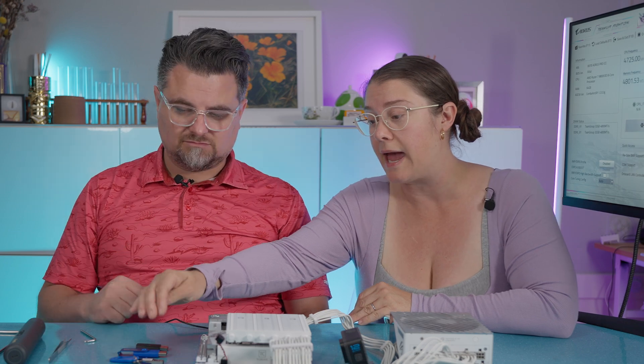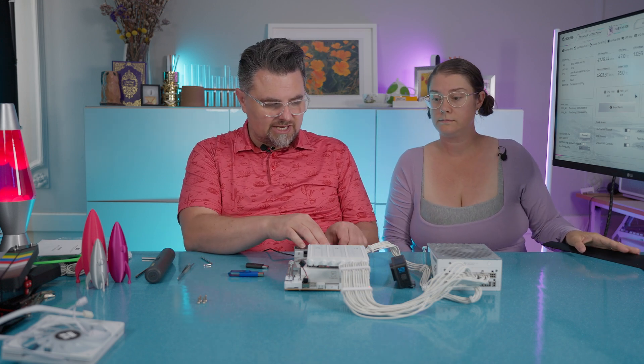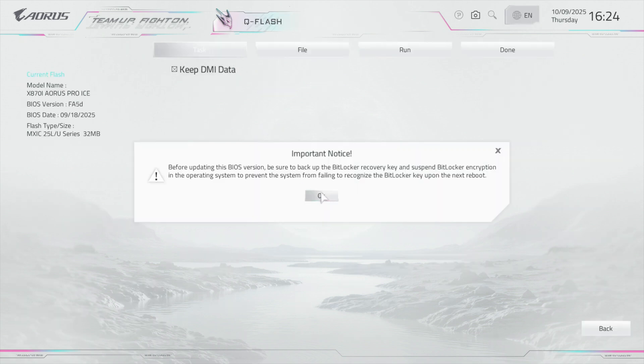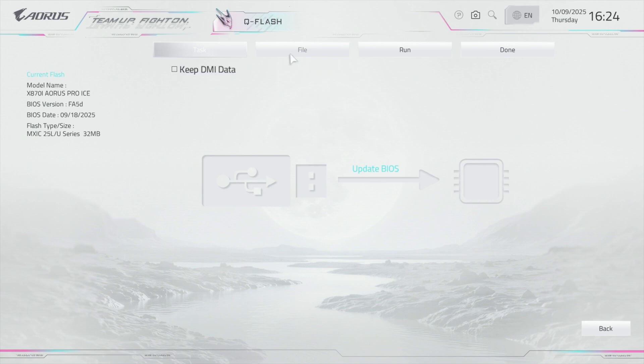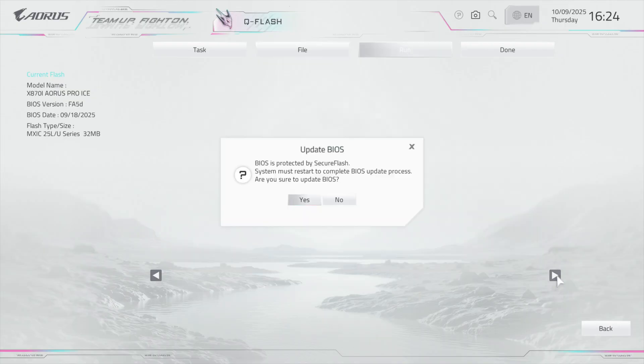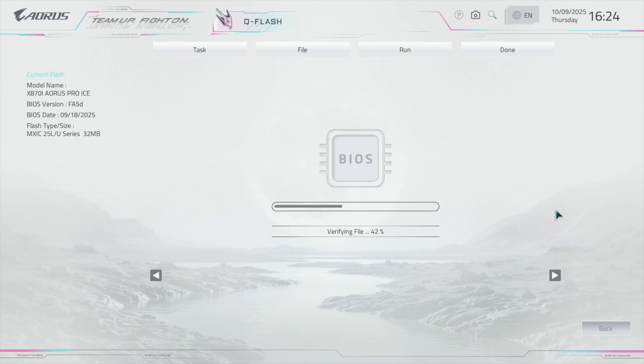As long as you have all of those factors correct, the USB stick will work with QFlash Plus. We have literally tried every single one and we know all of these worked. If you're already in the BIOS and you don't want to mess with QFlash Plus, you can also just take one of your USB keys, plug it into any port, and go to QFlash in the BIOS menu. You can go to file, and this way you can see the file name — this is why I like to just leave both versions of the files on there, because if the drive only had GIGABYTE.BIN you wouldn't know what BIOS you were going to flash.